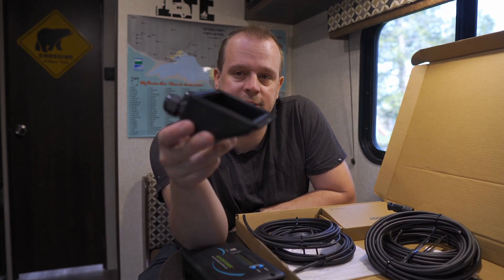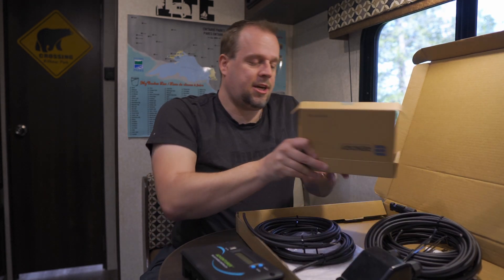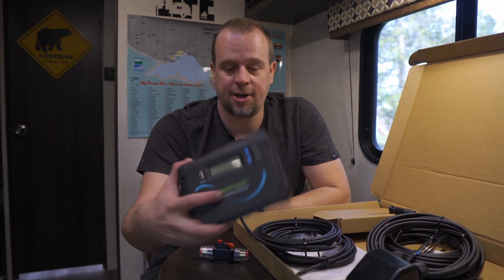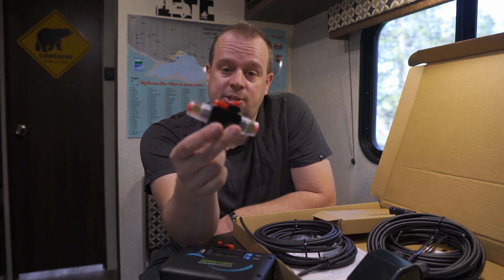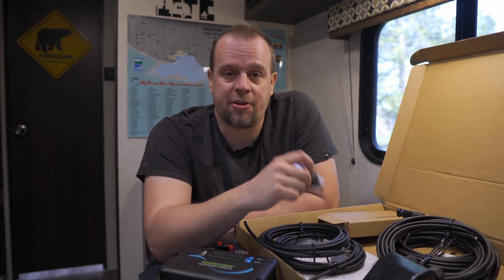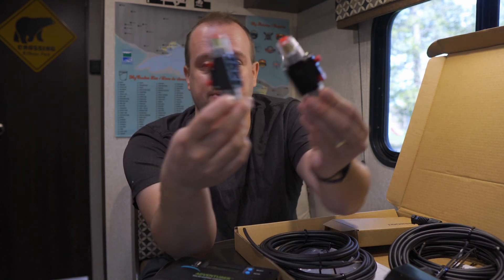I'm not sure I'll need the solar cable entry gland today — I'm hoping to reuse the fridge vent above the AC. The kit also comes with mounting hardware. In addition, I got some 30-amp breaker fuses separately — make sure you match the amp rating to your controller. These protect your solar panels and charger, and a really nice feature is you can easily disconnect them. The manual doesn't clearly state it, but you have to hook up your battery first. If you don't have a breaker in between, the only way to disconnect is going back on the roof to unplug the solar panel.